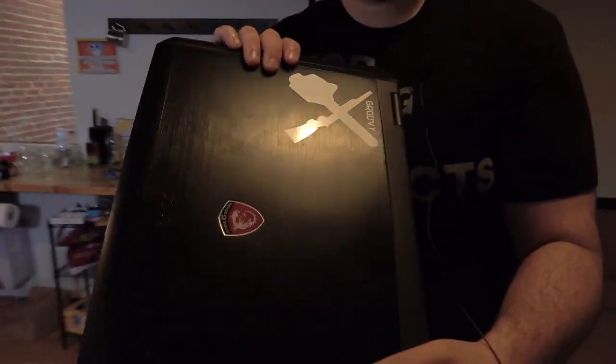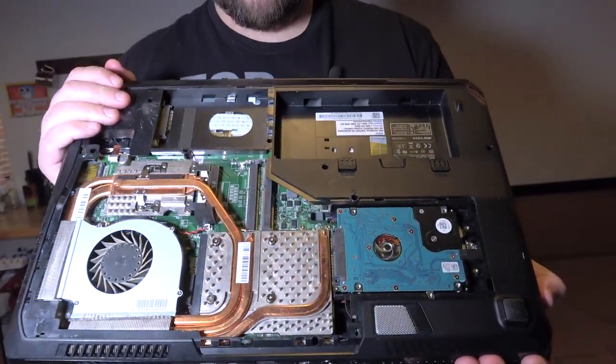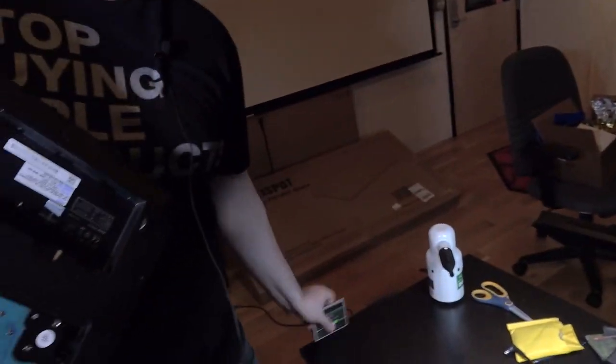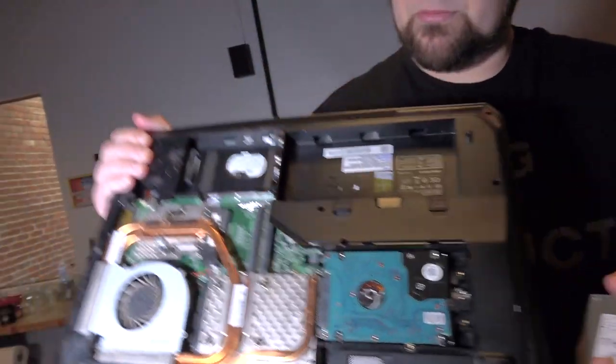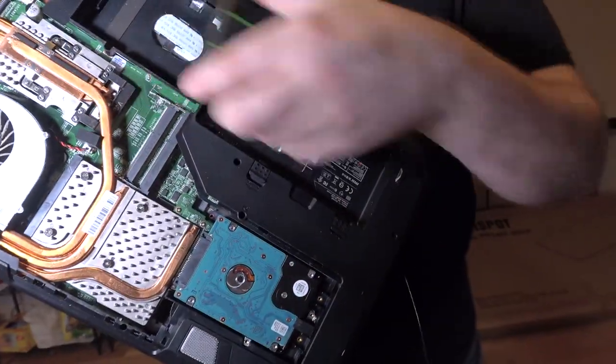The first thing is fixing Justin's laptop — something you guys should do if you have an older laptop that needs an upgrade. This is an older laptop, just a couple of years old. It's got something like a 960 or 970, so it has a decent graphics card, but it's got a regular hard drive in it. A lot of you who have purchased laptops in the last few years will have one of those. The biggest upgrade you can do is not upgrading your GPU or CPU — if you've got a regular spinning disc, putting in an SSD is going to save your life.